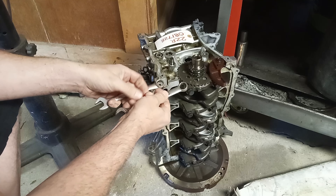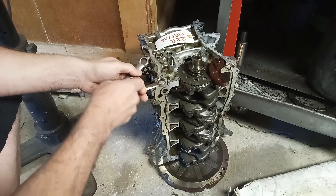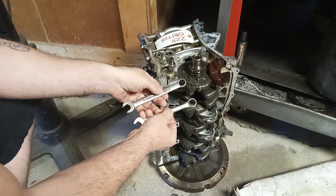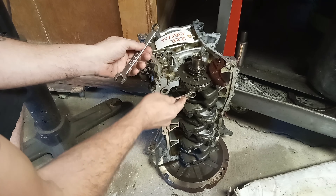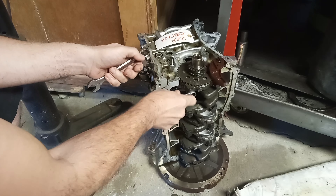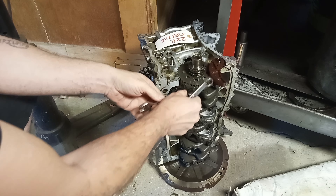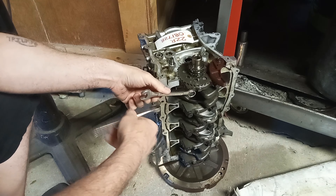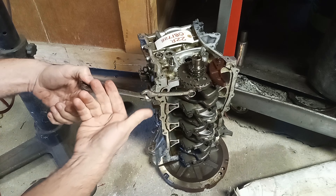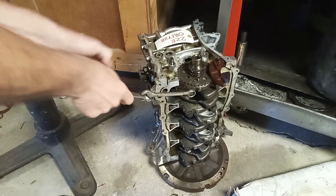So you want to take and double up on your wrenches. But before you do that — this is why it's a two-in-one — notice that 14mm is supposed to be the same as 9/16ths. But is it? The 14 on there, you got a little bit of slack, but the 9/16ths, you got a lot of slack. So not exactly the same. So put the 14 on here, then use the 9/16ths for the added leverage. Not only do you have added leverage — which is just free strength — but you're further away from everything that's going to cut the crap out of you.